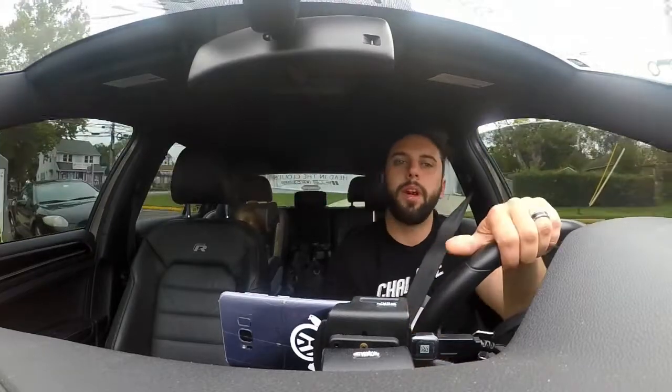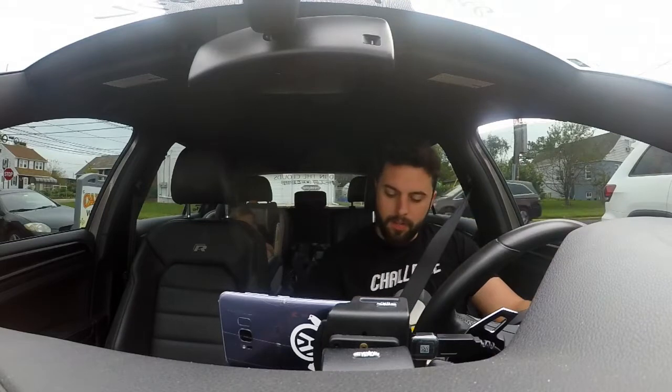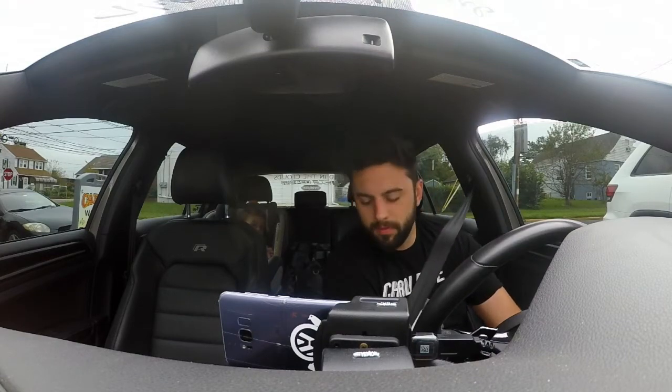You have to account for a few more things in what the boost gauge with the premium package or the performance package is actually reading. So no, you're not running 29 pounds of boost from stock. They say you're supposed to subtract like 14 to 15 pounds off of that number to see more realistically where you're at, which, if you did that, seems to be around 14 to 16 pounds, but I still have nothing accurate for sure.